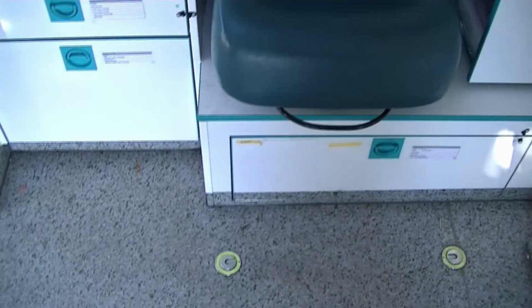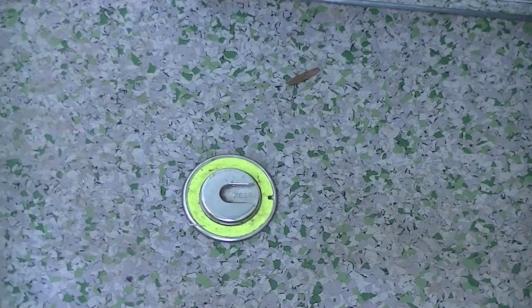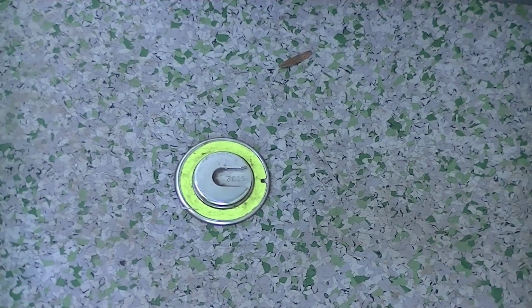I've taken out the stretcher supports. I'm very curious to know what these are. I think they're tie downs. If you put a screwdriver under it, that pops up by about 10mm. They're huge bolts underneath. They don't actually secure the vehicle to any part of the chassis. They just bolt through. But because it's spring loaded, what I think is a tie down, the actual threaded part is quite enormous. But I'm going to leave those in. We may actually end up changing the floor, but they're too big to take out. We'll use them because they may actually be useful as tie downs.